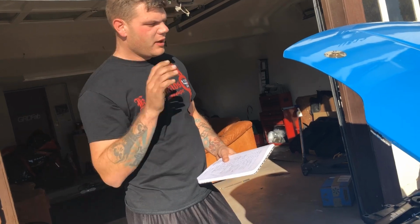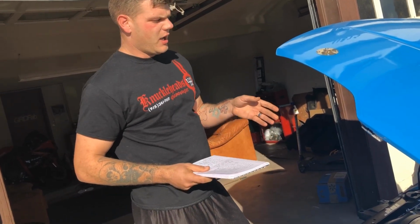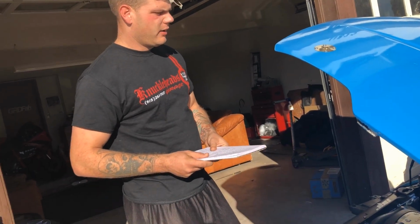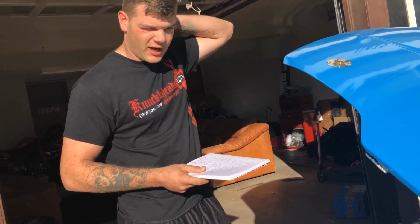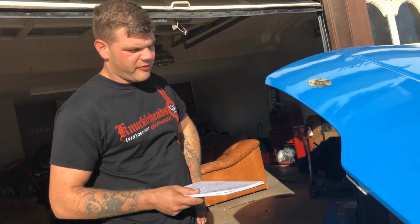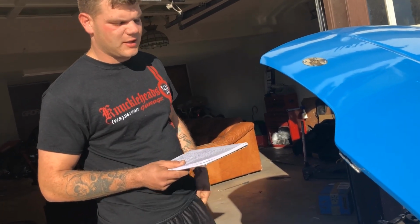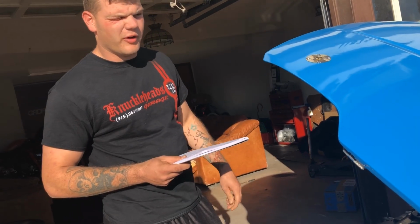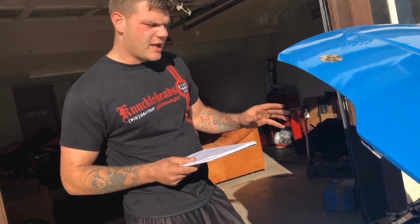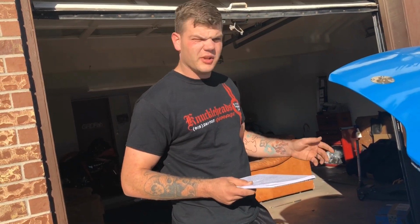Let's see, so the next thing that goes along in that same area is the clutch kit. I ordered a Jim Wolf clutch from Z1, and it cost me $399. It's broken in now and everything, and it doesn't slip, it doesn't do anything crazy. I think it's 1200 kg of clamping force. I guess it'd be like a stage 2 clutch, and no complaints there at all.